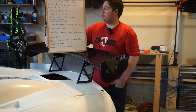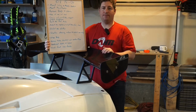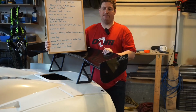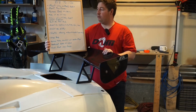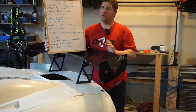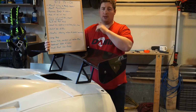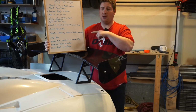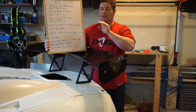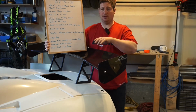So check the compression, then I'll drain the oil. I also bought an oil filter cutter, and we'll just look for any bearing material from running it in low pressure. That'll help decide the urgency of a possible rebuild. I'm going to build a new fuel tank for it. I'll get into all the details of that later. It's going to be a really sweet trick and solve any fuel slosh issues.